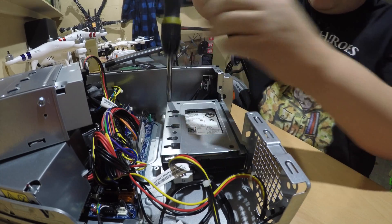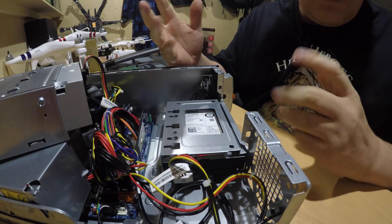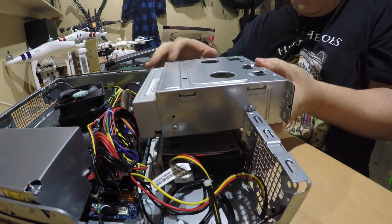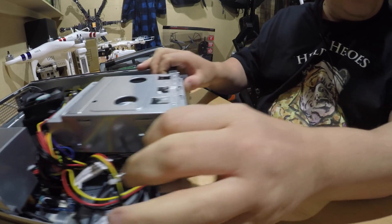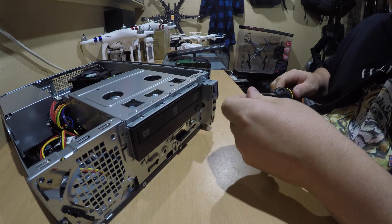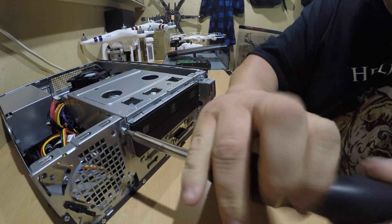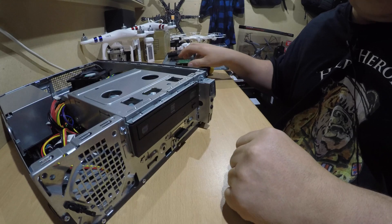There's only one space to put a hard drive in this. If you're upgrading, find out from the manufacturer what the board limit is on hard drive size. If it says it can read up to an eight or four terabyte drive, buy the maximum to put in because you don't want to upgrade later. So that drive's in. Now we'll put the DVD drive back — just flip it back over gently and line everything up, and it should slide back into position.